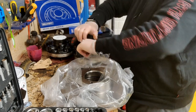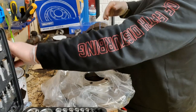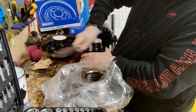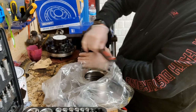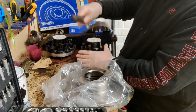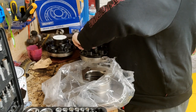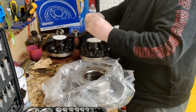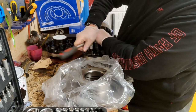If you're doing a modern European car, everything on it is going to be metric, as in M12, and even the Japanese stuff, it's all metric. So you're going to have 10 mil or 12 mil or even 13 mil bolts, so you can do the whole car with just a couple of different spanners. But Jags were made in the 70s and 80s in England, so you've got a combination of UNF and UNC, which is either fine threads or coarse threads. I can't remember what the UN stands for.